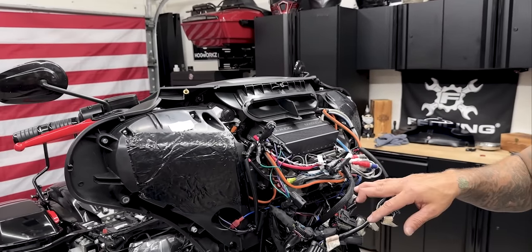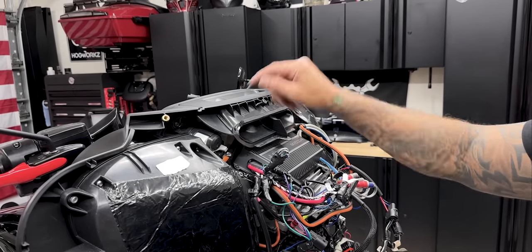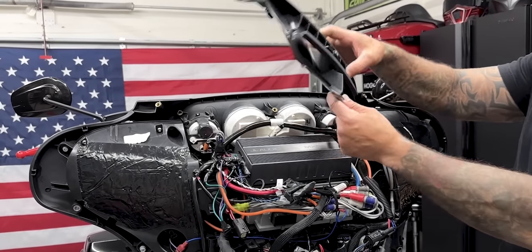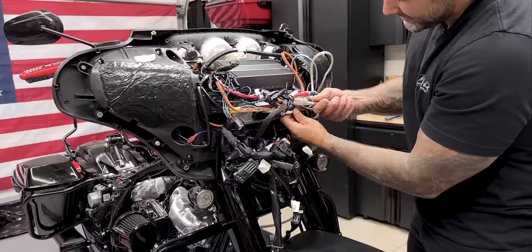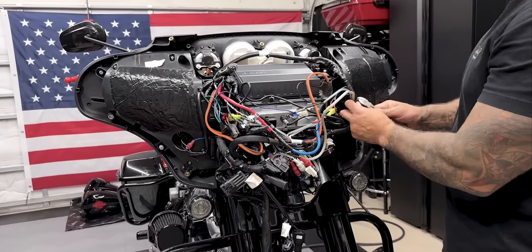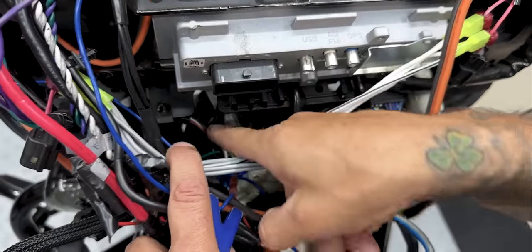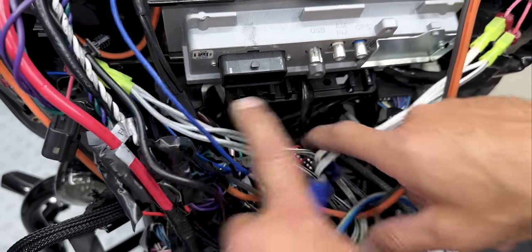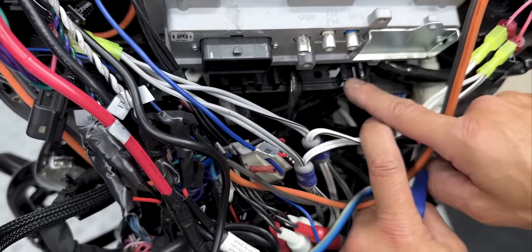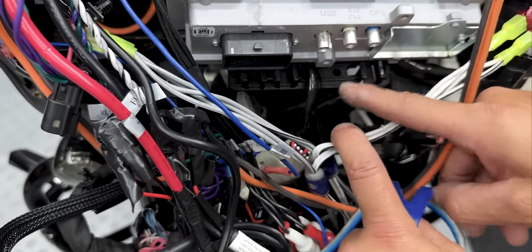Because this amp is hardwired in and leading towards the back, we have to remove the vent and also remove the amp so we can drop it down. To remove the vent, you have two screws on each side — they're T27. Then slide the vent back. At this point I realized I had to disconnect everything — a lot of these wires are hardwired into the amp and running towards the back. That's why I'm a big fan of plug-and-play, so you can quickly disconnect wires and pull the fairing off. Here you have your twist grip sensor — pop the Christmas tree out and disconnect it. You'll have your right handlebar switch harness with the run/stop switch and your left handlebar switch harness. We'll find where they're disconnected and get them disconnected.